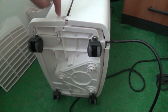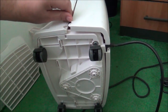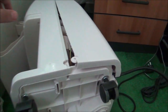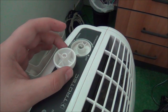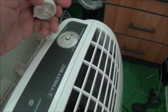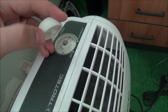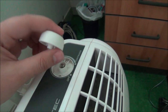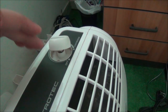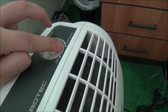There's one screw on each side, and the back is going to come off - not 100% easily, you need to pull on it a little bit, but not extremely difficult. Before pulling the back out you need to remove this knob right here, and it's not going to come out really easily because of its shape - you don't really have anything to pull on. Try and put something beside it and pull it out, but don't bend your plastic. I bent it just a tiny bit right here, so yeah, not ideal.